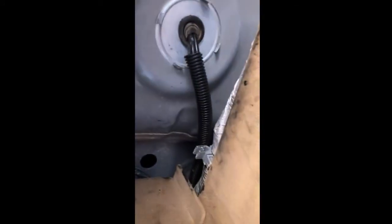It runs down here on the inside. There was a little channel in the body that I ran the other two wires through, but this one I had to run on the outside. I'm not overly excited about it, but there was no way to get it down through the tube portion, so I put some wire loom on it for extra protection and wire-tied it off. Another wire tie connection comes behind the frame mount, and then it goes into the cab with a rubber grommet. All three of them go right in there — that's the underneath look.